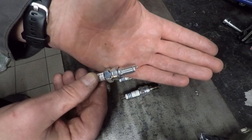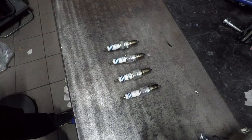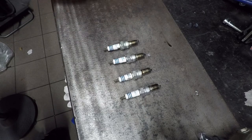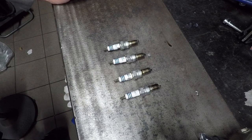And I'm going to fit a set of new plugs — I think it's about time. Even though it's only running 18,000 kilometers, this bike since 1994, I think this one is way too sooty. It's probably been started and stopped cold with choke many times. They seem to be totally fouled, so we'll replace them and carry on.